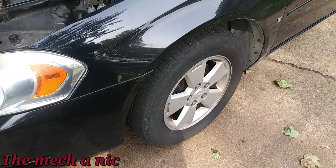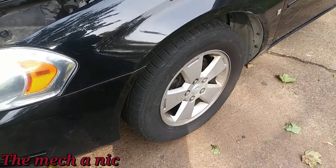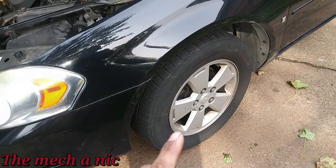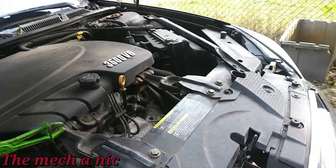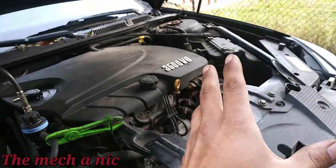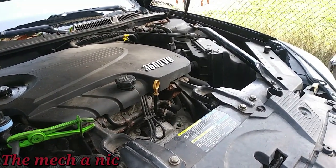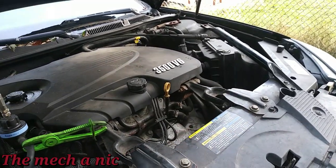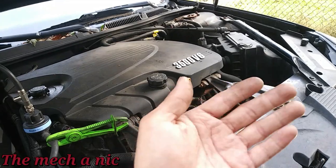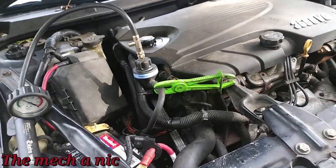It's time to do the front brakes. When I initially jacked up the car on the street I thought it had a bad wheel bearing, but when I took it out for a test drive and went around the block two or three times I didn't hear the classic wheel bearing noise. Once I jack up the car to do the brakes I'm going to double check whether it's a wheel bearing and not a lower control arm or ball joint. I jacked up the car and confirmed it is the wheel bearing — the ball joint and lower control arm seem okay, all the play is from the wheel bearing. Because of that, I'm not going to put new pads and rotors on today, because I'd just have to pull everything back apart to do the wheel bearing later, and a loose bearing could cause uneven wear on the new brakes.